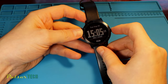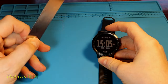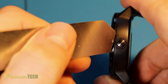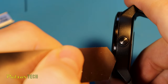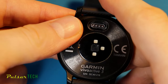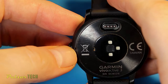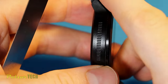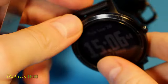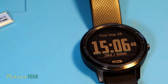First let's talk about the tools we're going to need. We will require a very thin but rigid metal pry bar that will allow us to get into the groove between the top part of the smartwatch and the main case body. Alternatively, you might use a small flat screwdriver, but it's better to use a proper tool. Since this smartwatch is water resistant, it has a special adhesive sealant holding the parts together. To open it up we will need some sort of heat source to warm up the adhesive and then use the pry bar to open it up without breaking the body.